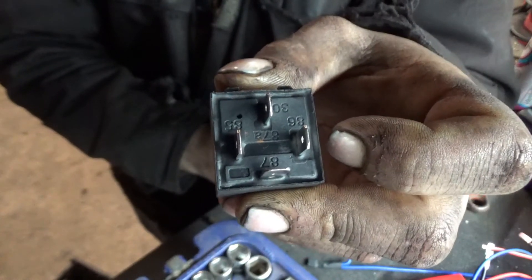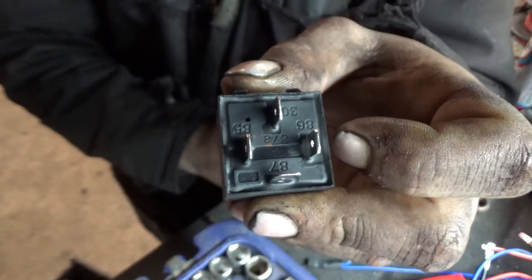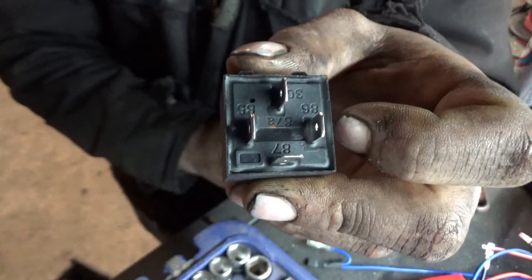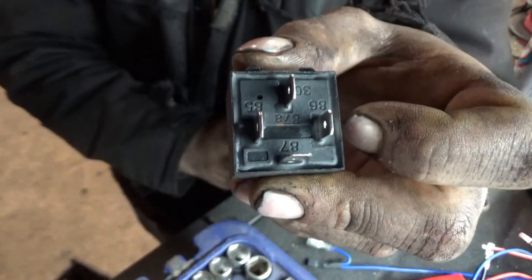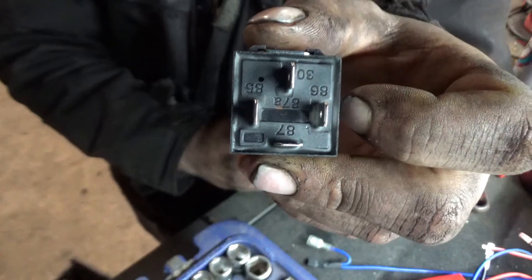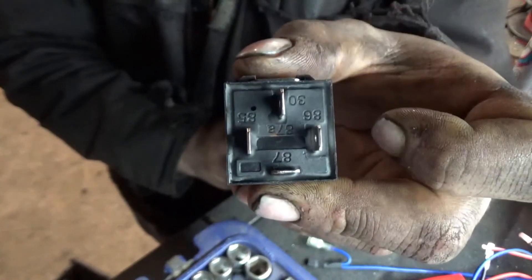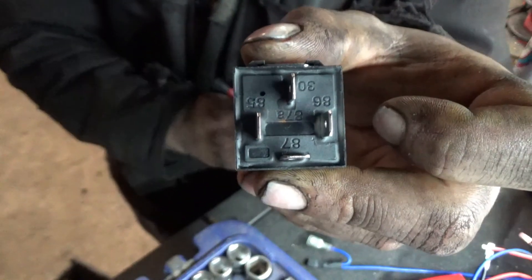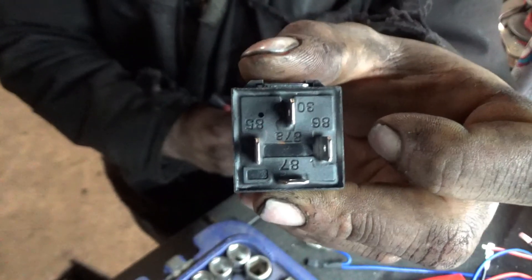So now you can go ahead and add those fog lights in without a pre-installed harness. You make your own harness, cut it to custom lengths, fit it to your needs, put a relay where you want it — it's going to be accessible instead of tucking it down and letting it dangle under your hood somewhere. Really good relays — Bosch-style relays — there's a quick how-to for you. Thank you for watching. Please like, comment, and subscribe to Pearson Auto.